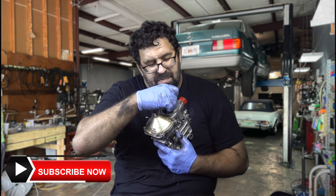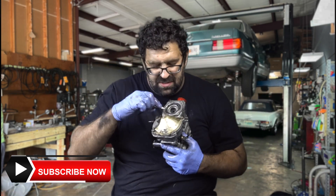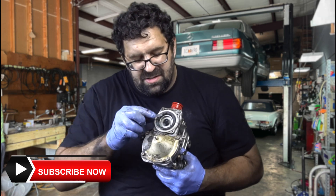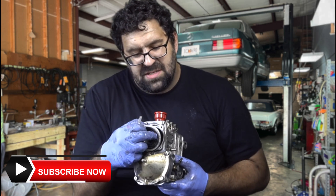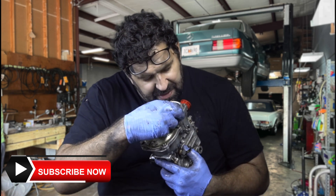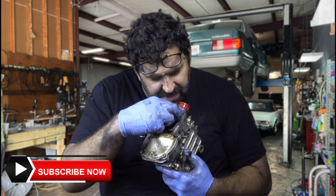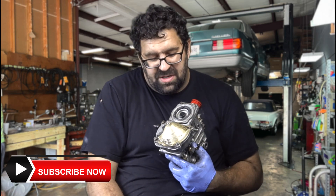So for operational cars — this is the leather diaphragm. This diaphragm actually sits underneath the rear cover, and what you want to do is use a flashlight to inspect the diaphragm for holes. This diaphragm can tear, and when it tears it will start very slightly but keep getting worse and worse until you develop these weird symptoms.